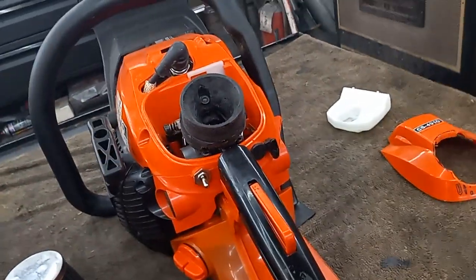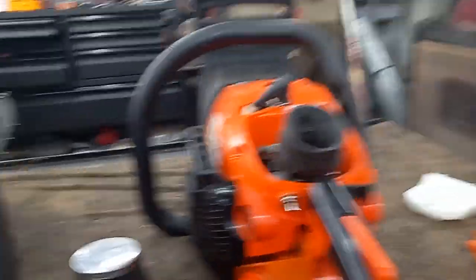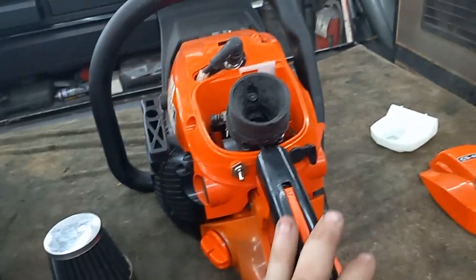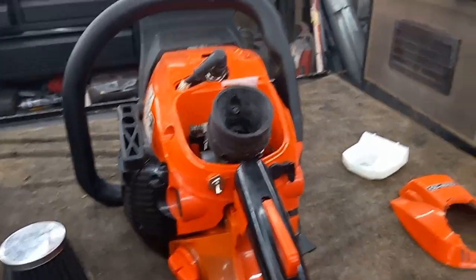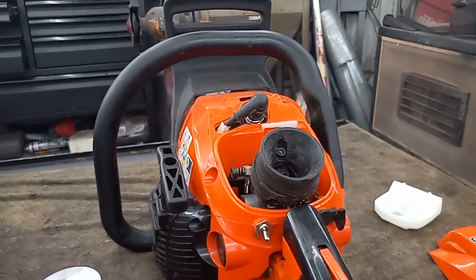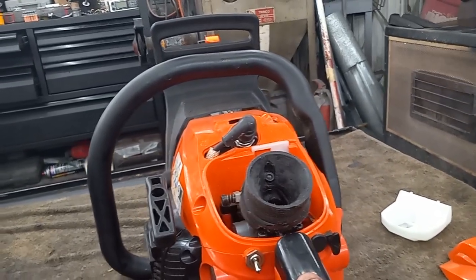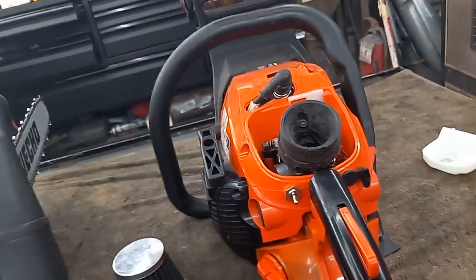This saw is running pretty strong. I really can't wait to get either one of these on the dyno and see what they make — I'm really curious. But I know there's more in this saw. Right now the carburetor's the limiting factor. But as much as I pushed the timing on it, I don't know if a bigger carb is going to be any more beneficial, because I made up for the small carb with a lot more intake duration.